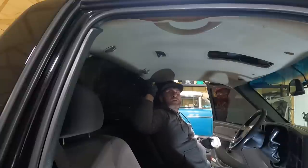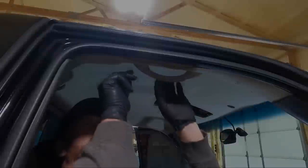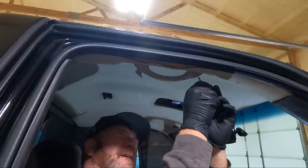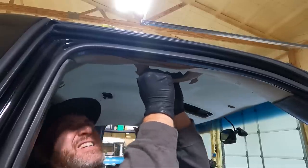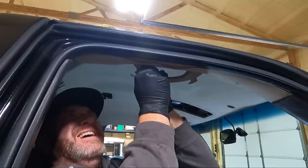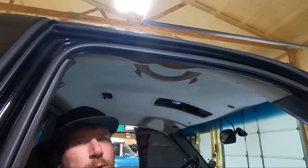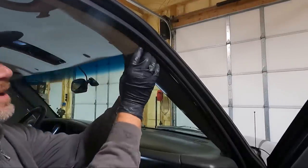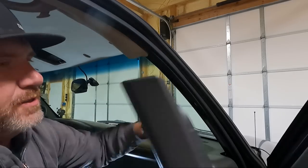These guys back here are a little bit different story. What I'm going to do next is there's a pull handle up above right here — I'm going to grab it out. For this I generally use a really thin flat blade screwdriver and kind of get underneath and pull those guys out like that. Now a couple of things can happen: you can leave this on — it will pull out of the roof once we get some more stuff loose. We'll pull this off because it'll have to be out of the way. The next thing I want to do is take the pillars out. On the pillar, if you get up here in the corner and pull straight back towards you, then it comes out of the dash — it's got two little pieces.